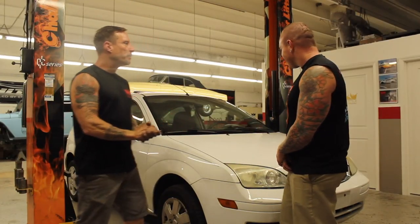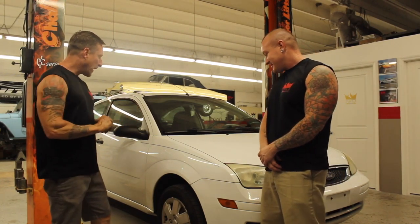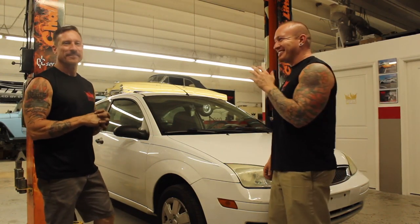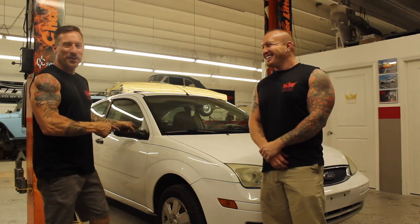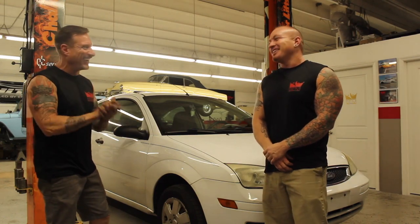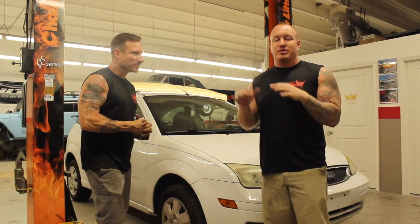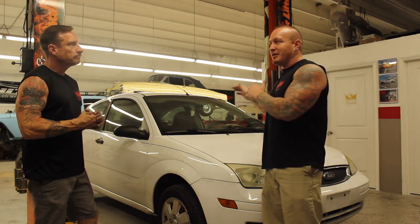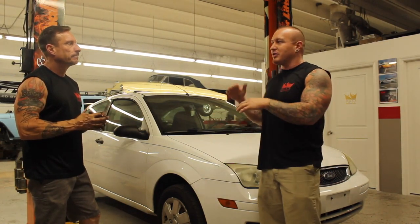So there it is. We've replaced the calipers, the hoses, the brake pads, the rotors, and put the wheels back on. Even salvaged two tires that had nails in them and a hubcap that melted down from the excessive heat. So this monster is ready to go in the streets. Not a bad install — total install time with two people is about an hour total, maybe just a little over an hour to get that bleed done. Top everything up inside the brake master cylinder reservoir and do a full wipe-down — brake clean everything after you're done.